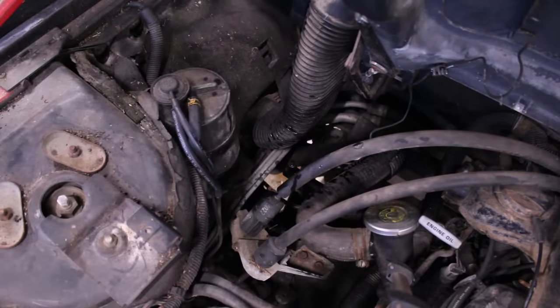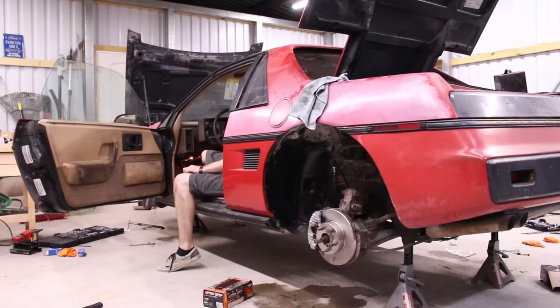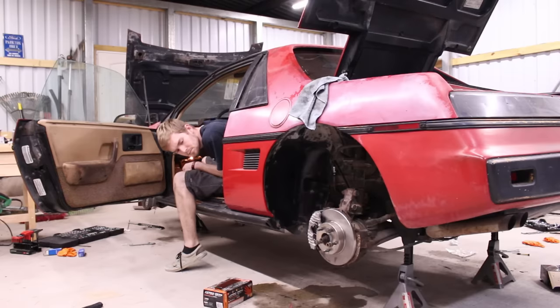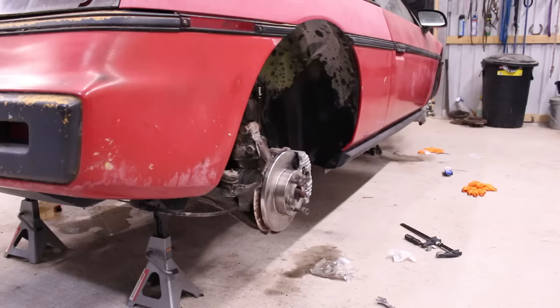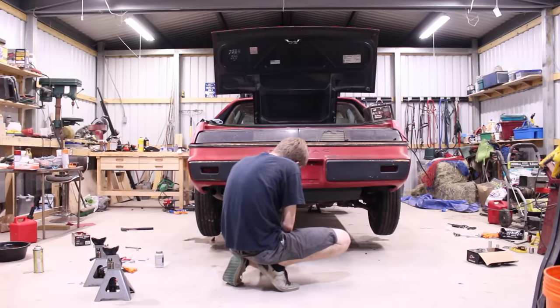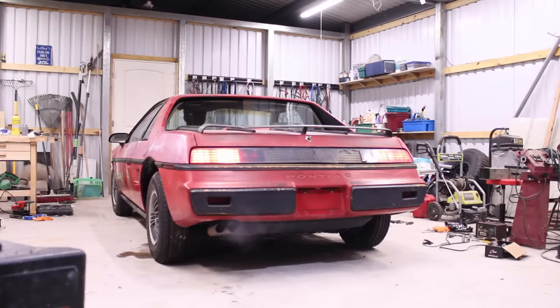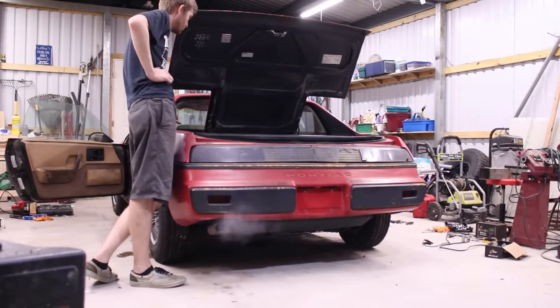Let's move on to seeing what happens when the car is put in gear. With the clutch pedal pressed in, the car is not wanting to shift into any gear. After a bunch of messing around, I did manage to get it into a gear, except there was a problem — I never let off the clutch pedal, yet the rotors were still spinning. The wheels were put back on the car and I lowered it down. Still nothing. There was full travel happening with the slave cylinder — that was certain. So what was going on?